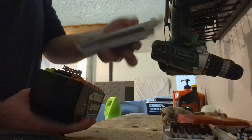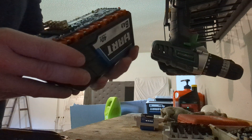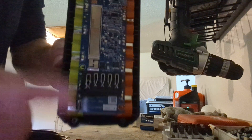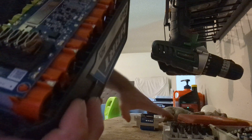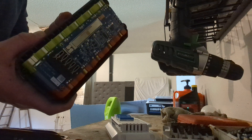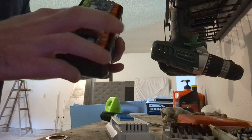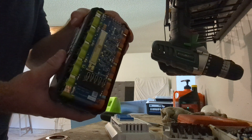Now the cover is off and this is what the inside of your battery pack looks like. You can see the chip and everything here. This piece right here is what's called your fuse — if this thing blows, the whole unit is done. Here are your charging pins: this one here is your positive and this one is your negative. I also tried jumping this thing to see if I could get a charge back — that sometimes helps with certain batteries — but this one can't be jumped. When I try, it sparks at the positive, so I know it gets power, just not delivering it to the battery.